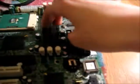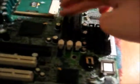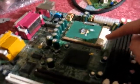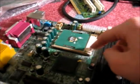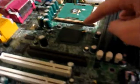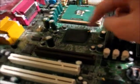And it has 3 SDRAM DIMM slots, so it's nice. And it's the PGA 370, which is pin grid array 370, 370 pins. And it has a Pentium 3 in there of questionableness.